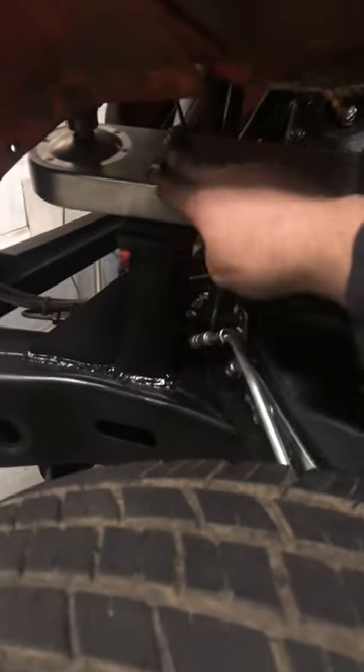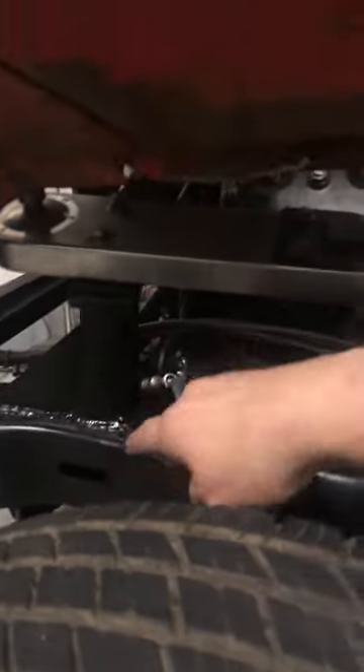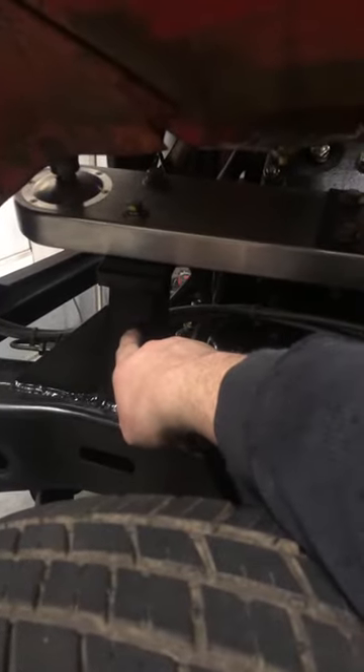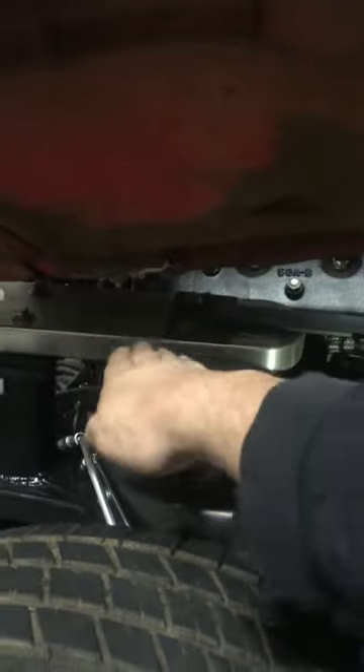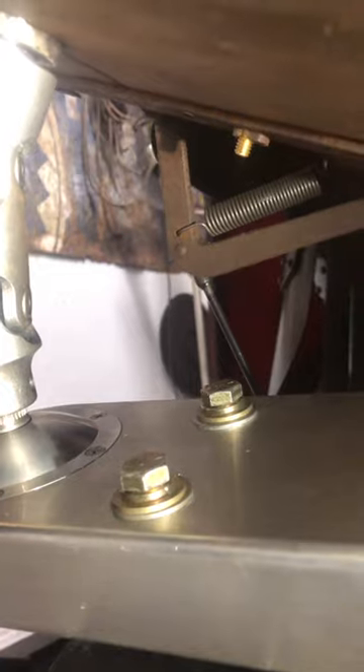I built this steering bracketry here. Got my 14 inch offset steering box — I use a trailer hitch with the proper angle here, and I just drill and tap this piece and run these 3/8 bolts into it, weld it in, put a gusset — just a two by two receiver that gives the perfect angle for the box there. I use the original steering column, cut it down, and put a double U-joint on it.